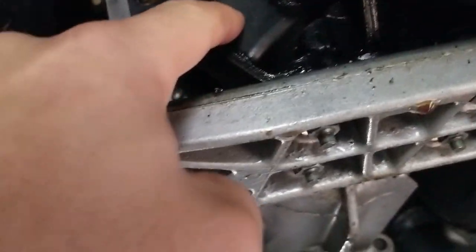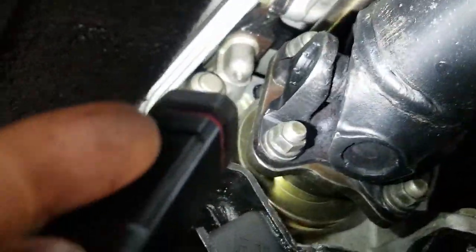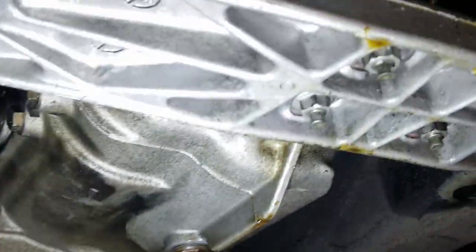And our oil leak, where is it coming from? It's coming from our favorite spot. This is what happens when an oil leak hits rubber. Rubber starts to swell. Let me see if I can get a light. So it is coming from the shifter. Looks like a little bit from the shift rod bushing up top, and also from the rear output shaft bushing. I do this all the time, very common. That's the only oil leak I can see.